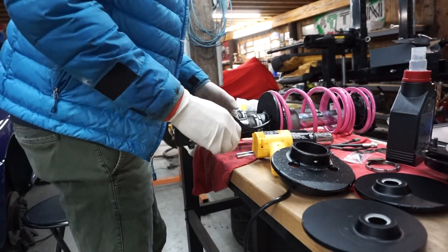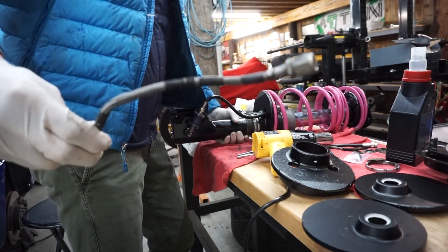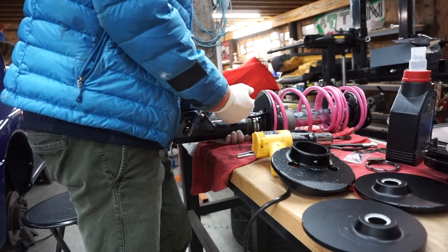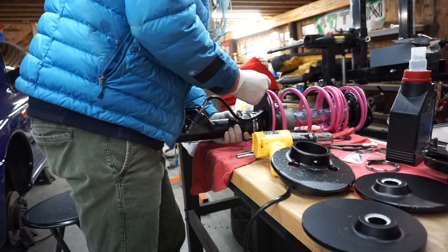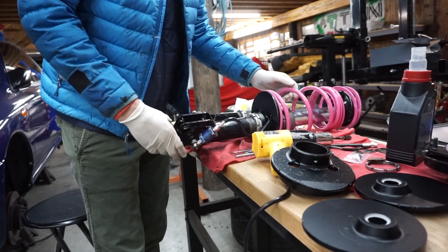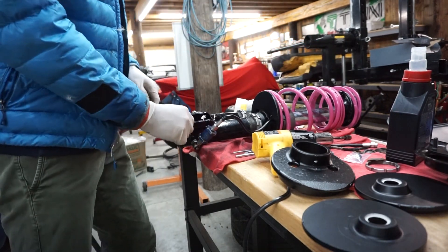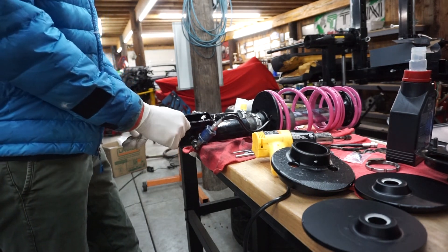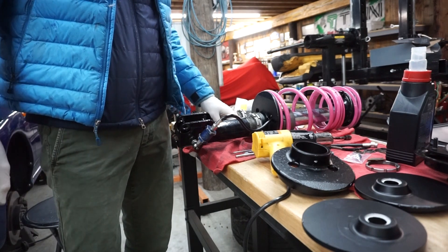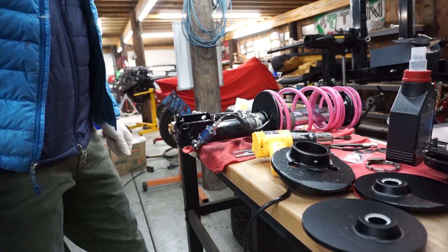There's been some off-camera wrangling but it's all together. What I did notice is the hoses that I measured initially — these guys which are dead — same length, but now that I've lowered the car I think it has an effect on that, just the routing mostly. It's not like the length from the top to the bottom didn't change, but the angle changed a little. Right now the height is matched to the height of the standard strut which I have on the floor. I measured from the top to the bottom hole and it's the same 24 and a half inches. I'm thinking when I put this down on the ground it's going to be dumped because this is going to compress a bit. I don't know how much the really soft factory spring compresses when you put the car down, so I've got to start somewhere. I'm just going to do it even though I fear they might have to come off completely to adjust the height. I guess we'll see.